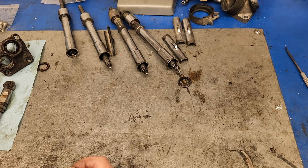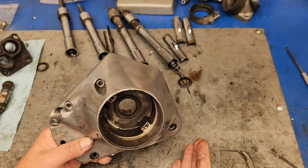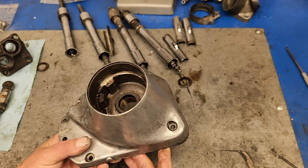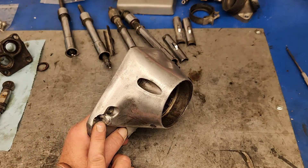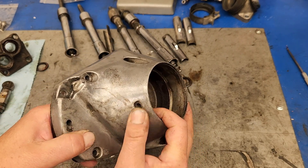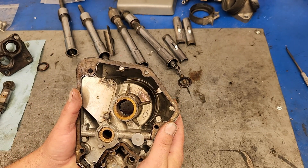As we proceed down the path here, we're going to look at the actual nose cone. I originally thought I might put a new cam cover cone cover on here anyway, because somebody had tried to beat it up with a screwdriver trying to get the timing cover off. This is an end oiler, so they plugged these ends after they machined it and they did a pretty sloppy job, but it's original. You can see all this slop from the weld that they didn't clean off after they welded it — pretty janky. But regardless, that wasn't the problem.